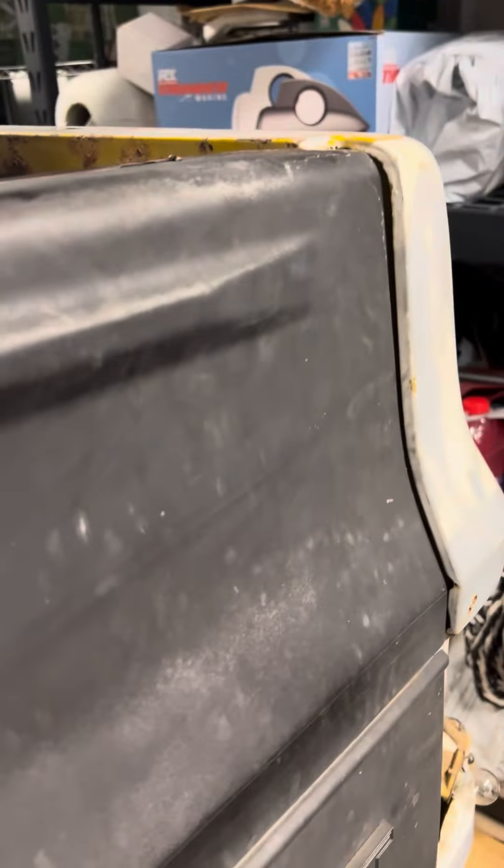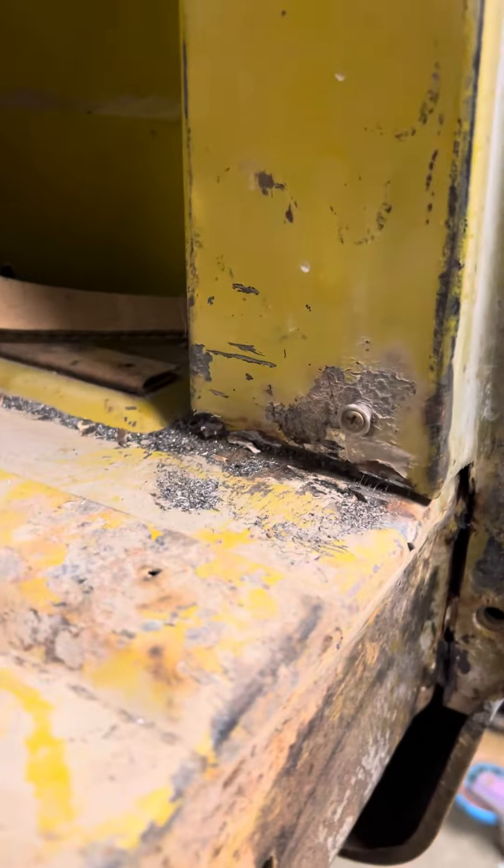There's no videos on the internet for these years. There's going to be spot welds all the way around this pillar that you have to remove. You're going to have a couple bolts up inside here that you have to take out and then obviously all the ones on the inner fender well.